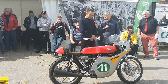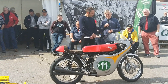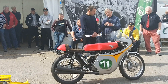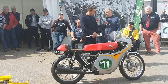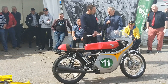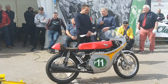I'd known about the bike for a few years and it had been passed around, with people adding bits to it, but nobody actually got the engine running correctly. When Ron built it, he put the three pistons rising together at the same time. So being a four-stroke, it fired two cylinders on one stroke and one on the other — which is what Laverda did with the first Jota, and then they soon abandoned that idea and made it a 120 crank.